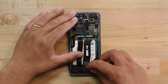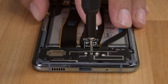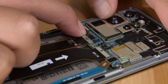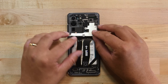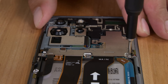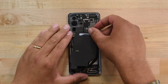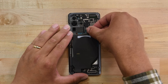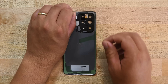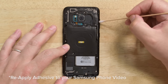Now go ahead and reinstall the loudspeaker and screw it back into place. You can now safely reconnect the battery. Next, lay the motherboard bracket back into place and reinstall the screw securing it to the phone. Grab your wireless charging coil and connect it first so that it is properly aligned and then you can press it down into place. Before you close up your phone, be sure to apply new adhesive to your back cover. We have a video that walks you through this process, linked in the description below.